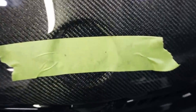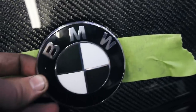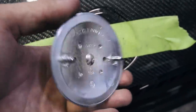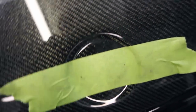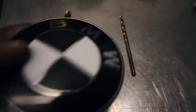Now with the hood fitted, I have the last and scariest part of the install — adding the roundel to the hood. To do this, we actually have to drill into the carbon fiber hood. I put a piece of painter's tape here, and I grabbed the back of the roundel, put some Sharpie on each tip, and laid it down as centered as I could. It made those two marks, so now I know where I have to drill. I'm going to start with a smaller pilot hole and work my way up to a quarter inch bit. I kept the grommets from the stock hood and found the perfect drill bit that fits right in there.